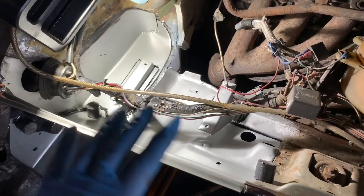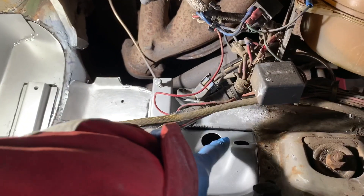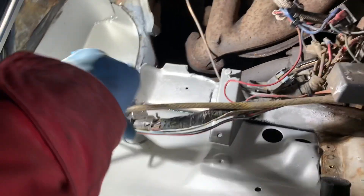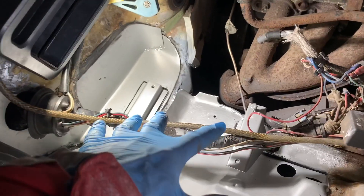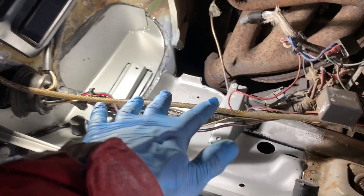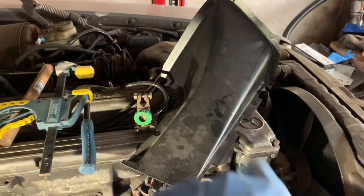I'm going to leave this video here. We've managed to get this panel in, we've got nice gaps all along here, and we'll come back and butt weld that. We're going to get a beautiful waterproof seal along here and along where this panel touches, so we'll come back and test that with water. We've got the battery brackets in — checked that they still match up with the battery tray, which they do. We've just got to seam seal everything and think about getting this next panel in.